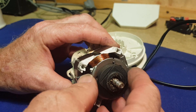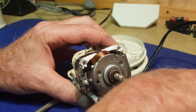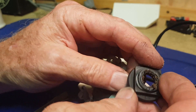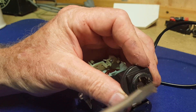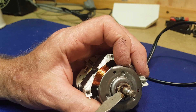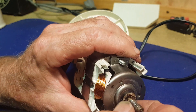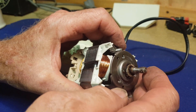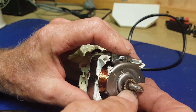That's a rubber mounting, that looks okay — just needs a clean up. Perhaps that was a rubber seal that went right up against the shaft and it's been chewed out. There may have been a fiber washer there as well. We'll need to give it a good clean up and get some penetrating lubricant — a good quality light oil — in there, and see if we can lubricate it and work out if it has a seal there or not.